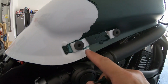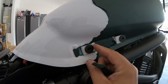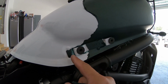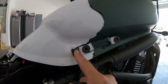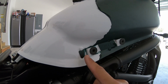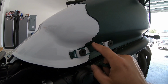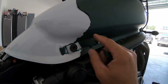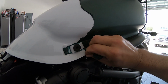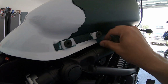And as you can see, this is where I was talking about, where I taped it off instead of taking this grommet out. But I think this time I'm gonna take that grommet out. And I also got some Plasti-Dip dissolver where it's real light right here. It might be a problem to take off, although now that I'm scratching at it, it's probably not. But just gonna make sure that's all clean all around these crevices. I probably need the dip dissolver just to make it come off easier. And once it's done, I'm just gonna clean up this tank, and it'll be ready to paint all over again.